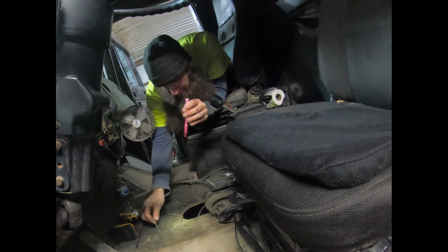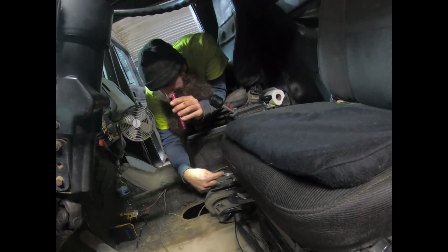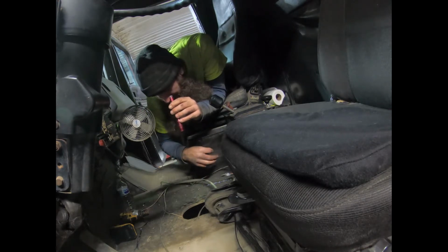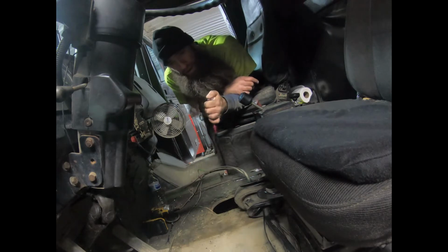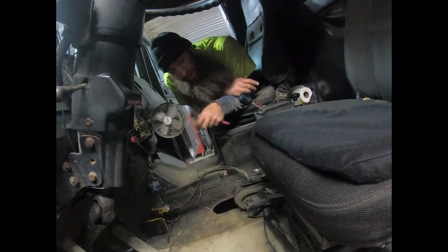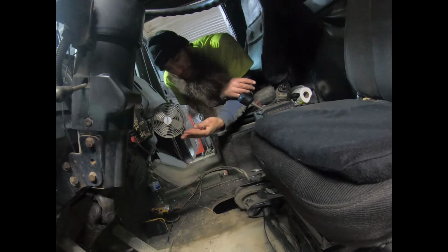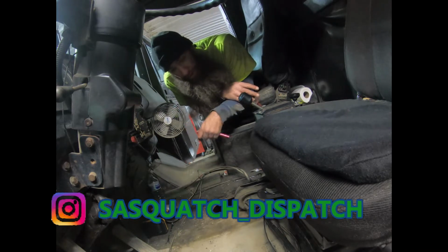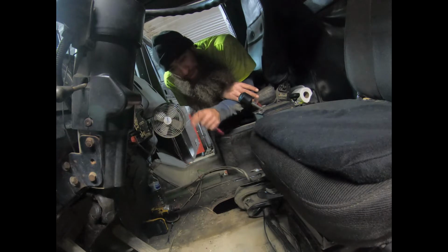The biggest thing was this blue line. It went to the back of the transmission and over to the passenger side, just over the side of the transmission. I think the only thing I've got left that could be a problem is there's another air tank underneath. It's mounted to, I'd say, the frame rail or the bracketry for the hydraulic tank. So it's not technically under the transmission, but when I pull the transmission back to get the shaft out of the clutch, I think the back of the transmission might run into that other air tank. So I'm going to take that off.